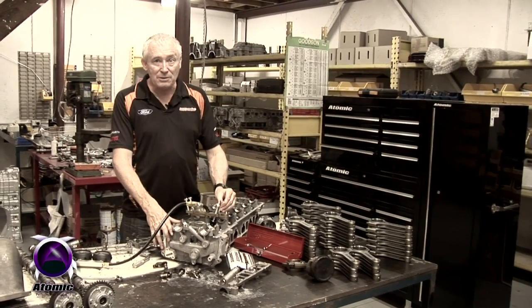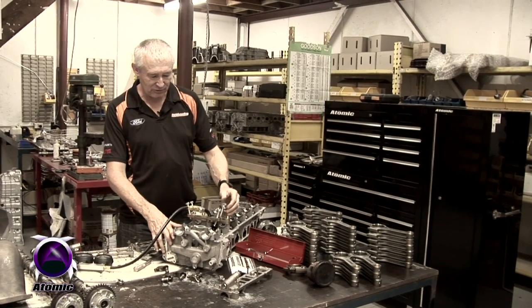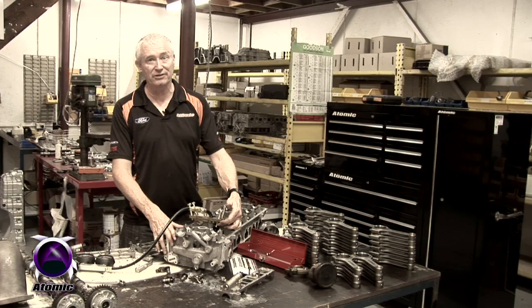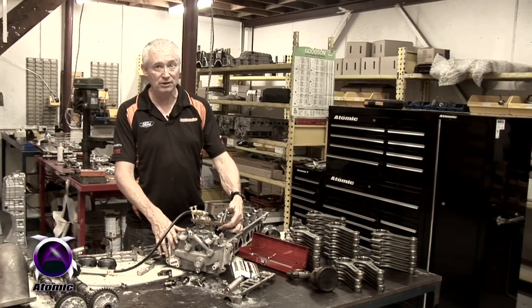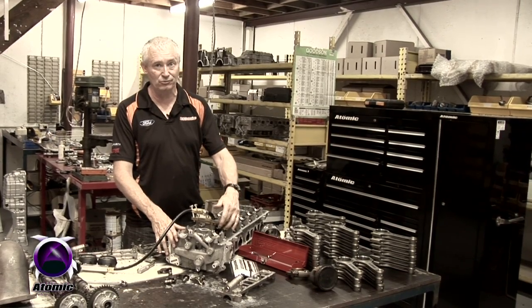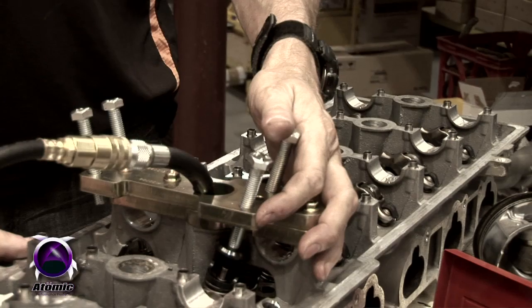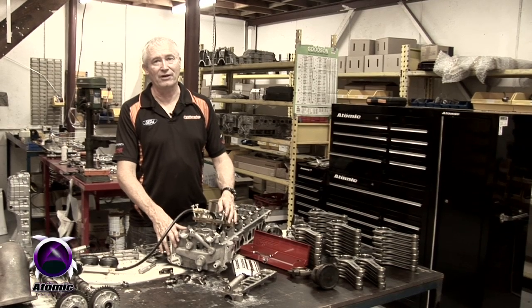As you can see, it's a very simple and easy-to-use tool. One of the main advantages is that it's nearly impossible to lose a collet into the engine. I've seen many professional workshops and Ford dealers who have lost collets into the engine when trying to use a fork tool or a lever to remove the valve springs. It's simple, it's quick, it's easy, it saves money — you've got to have one.